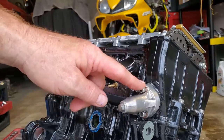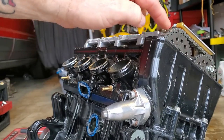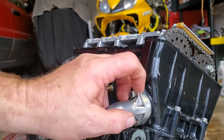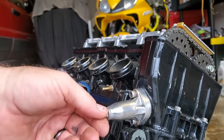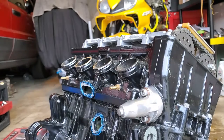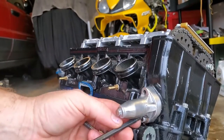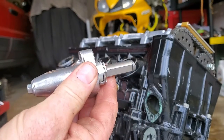The next thing I'm going to take off this engine is this piece — this is an automatic cam chain tensioner that keeps the cam chain tensioned. For a road bike this is fine. If you were going to race this and really know what you're doing you could get a manual one that you tension yourself, but for my purposes this is good enough. There's no need to take this nut out — these are a hex bit, specifically a number 5 hex bit, and they have brass or copper washers for each one so don't lose those. Then this piece just pulls out. I'm going to package this thing and put it away.